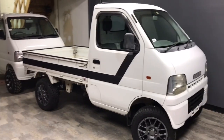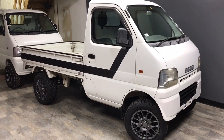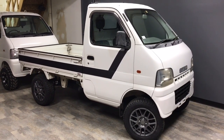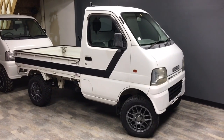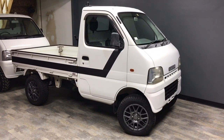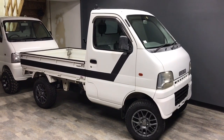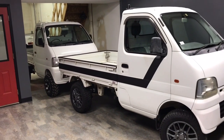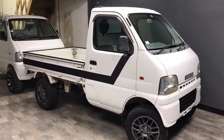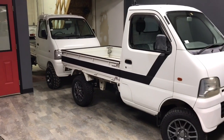This makes a nice little acreage or farm unit. I wouldn't expect to see this thing going out as a hunting unit or a mud unit — the 3-speed automatics' gearing is just a little too fast. They don't have the high and low range setting like the 5-speed units do. That unit right behind it with a 5-speed manual and high-low range is what you want if you're going to throw off-road tires or tracks on it.